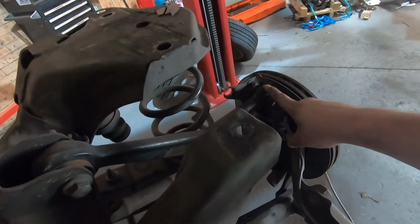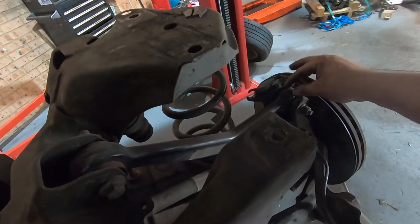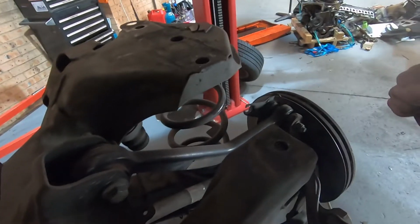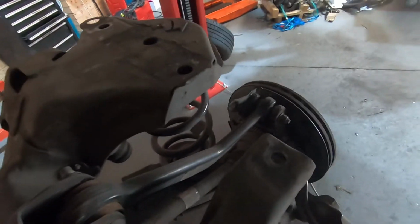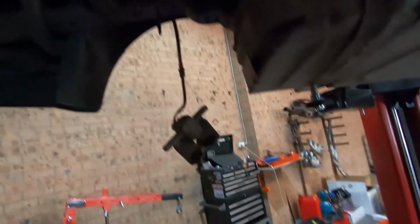like the upper camber arm. So these outer rose joints normally flog out, and you'll be able to move the wheel back and forth. So they generally will cause a little knock as you go over bumps. I've got a bit of stuff stuck up there. Cool.